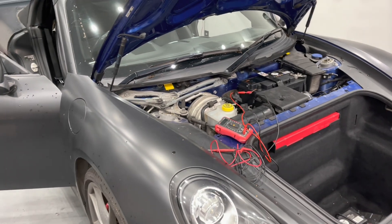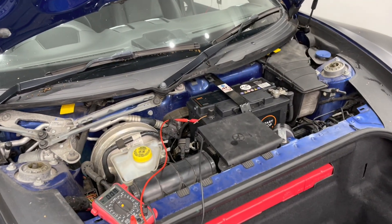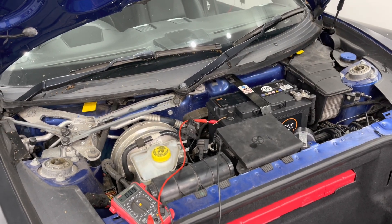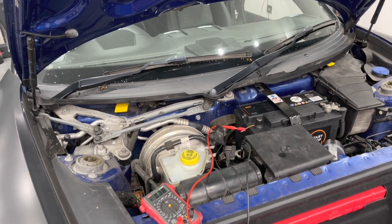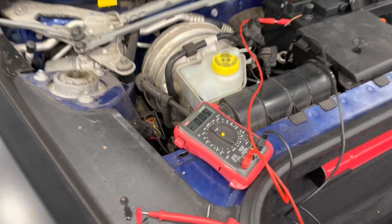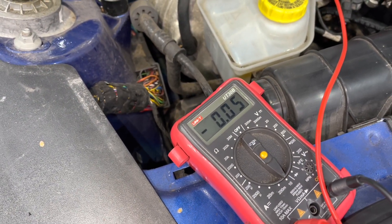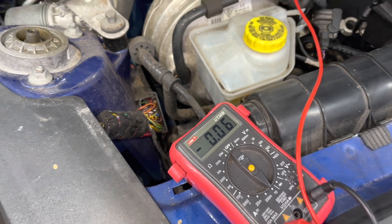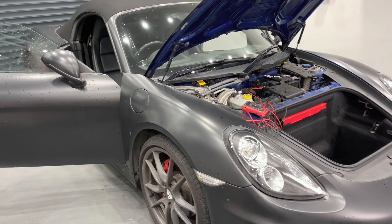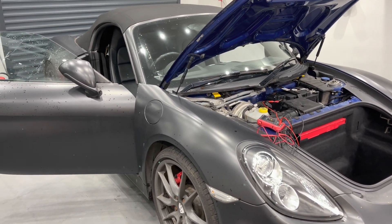This is a very common fault on Volkswagen alarm horns, which are obviously also fitted to Porsches. In this case the leaking battery inside the horn caused the body control module to stay awake. The reading is down to 50-60 milliamps with a bit of fluctuation. We hope you found our video useful — if you did, please hit like, share, and subscribe to our YouTube channel. Thanks for watching.